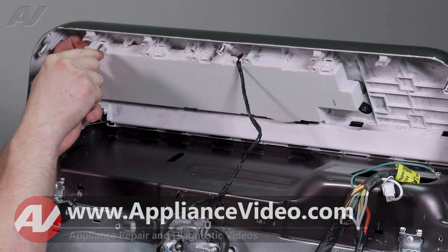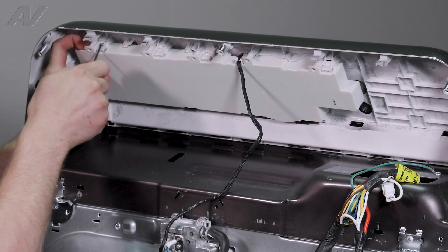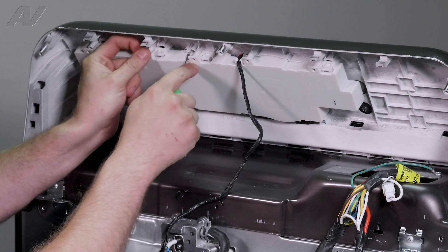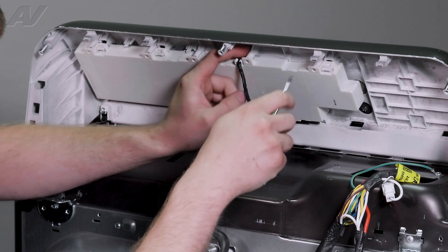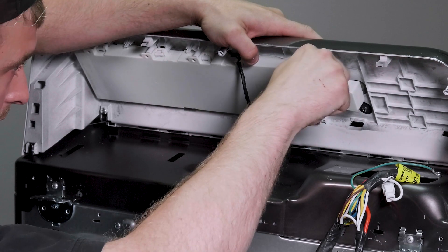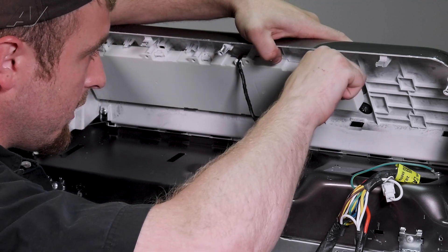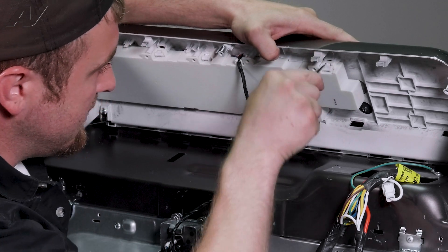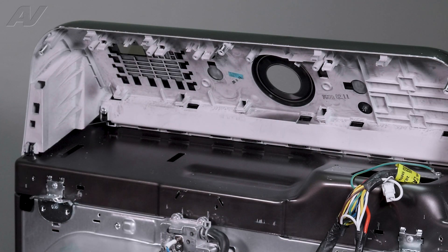What I recommend doing is start with the first one on the left — push in, slide underneath the locking tab, and then lift up on the second one. You'll see we're starting to pull out here. Start to pull out on this one, keep going around. Now we're on the final side. Sometimes it can be rather hard to pop it down, but use a screwdriver or something to get some leverage. Pull out on the user interface and set it to the side.